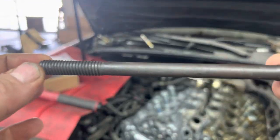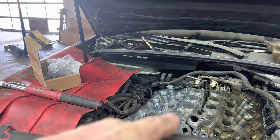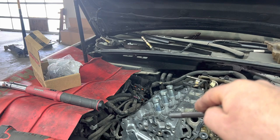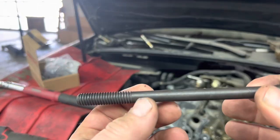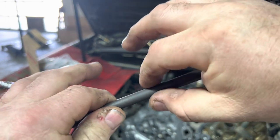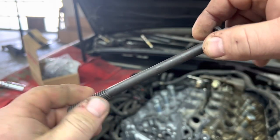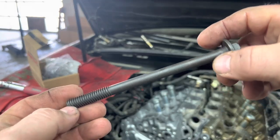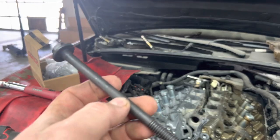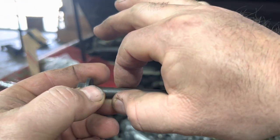Here are our new bolts. The purpose of torque-to-yield — you see how long this bolt is? You have aluminum, and it expands quite a bit more than iron does, it's more elastic. In order to keep that head gasket tight at all times, they use longer threads. You torque it down and then you turn it an amount, and that stretches the bolt out. Because this is a steel bolt, it's very elastic, and it basically acts like a spring to hold the head down onto the engine during heating, expansion, and cooling.